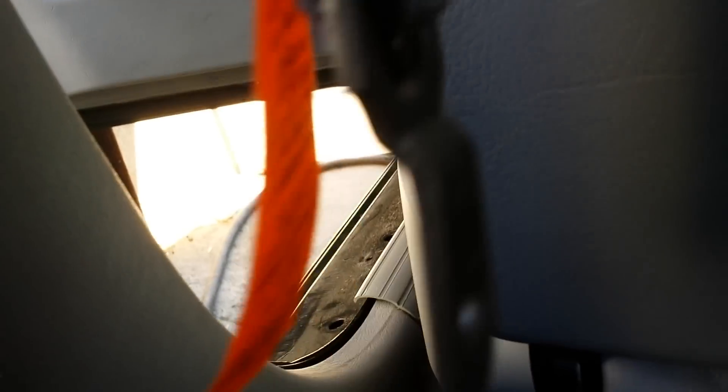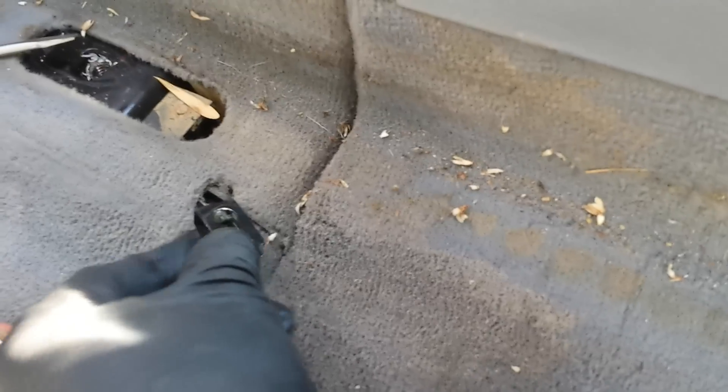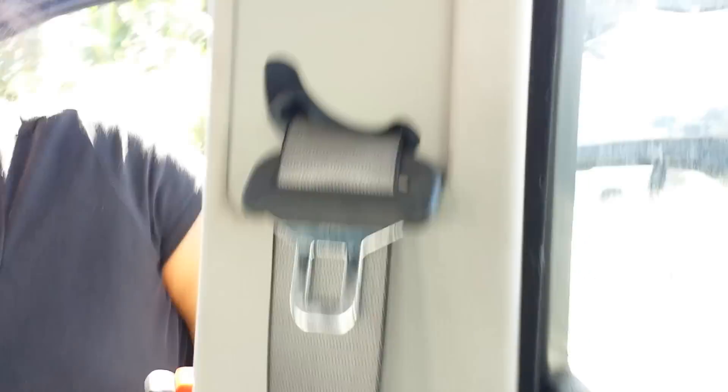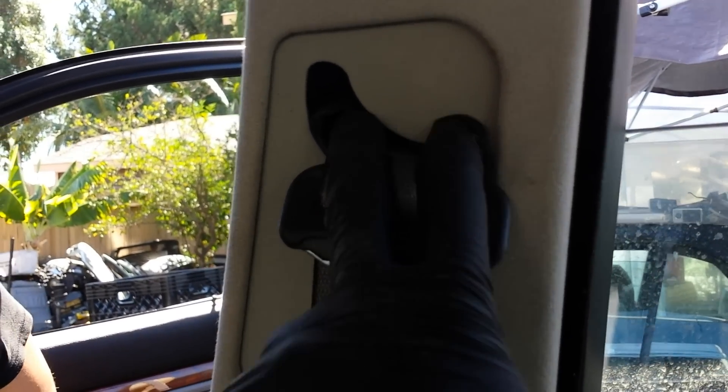Next, look back here at the side — there's a wire that connects here. What this wire does is: when the seat moves forward, it controls this section here, either moving it up or down, so the shoulder strap sits properly on the chest of the driver. That's what this function right here controls, and it's very simple to remove. As you can see on the passenger side seat we already took off, this is the cable that hooks out to the seat. When you push the seat forward it brings it up, and when you push the seat back it comes down again.